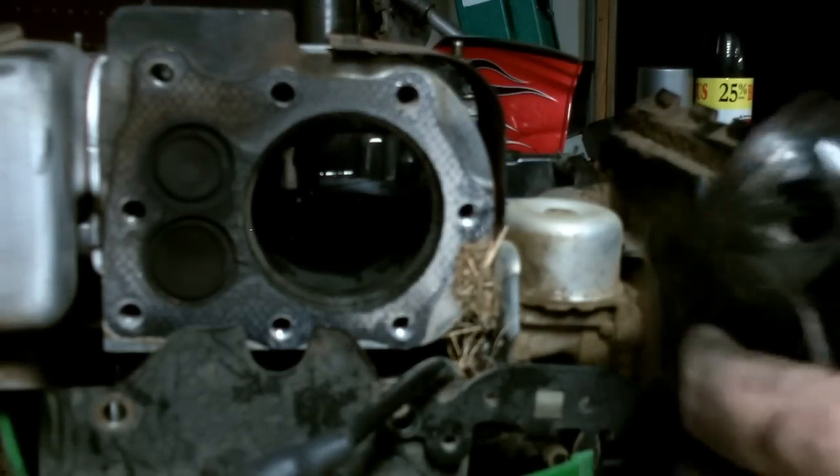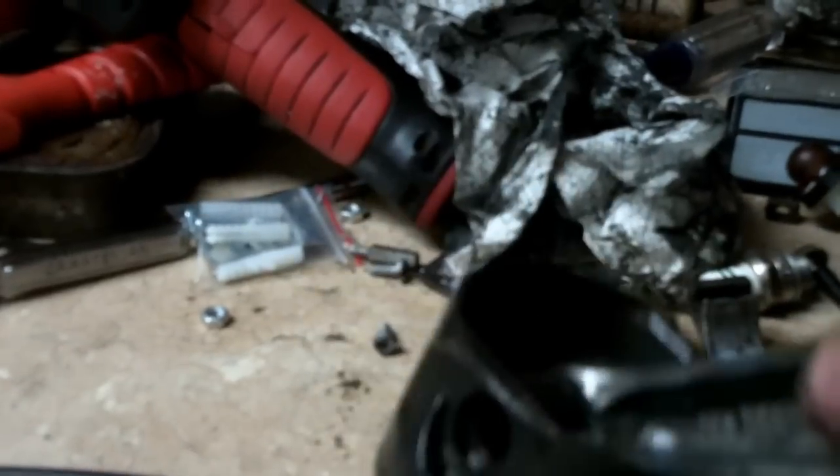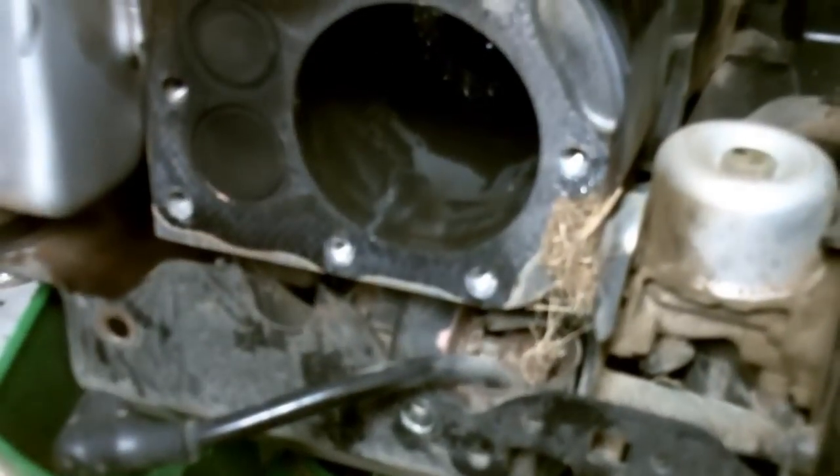Pretty good gap. Man, oh man. Ring groove city, and pretty good scoring, but lack of maintenance, that piston should just be nice and shiny and bright and not full of metal shavings, a mixture of oil. So that's just grit, but you have to take care of these engines, folks, or it'll do this. And don't keep them in a pool house full of chemicals either.